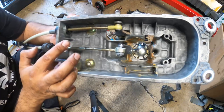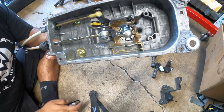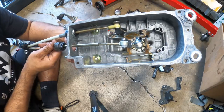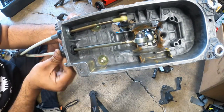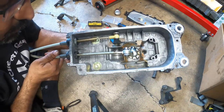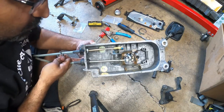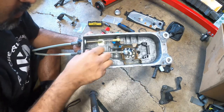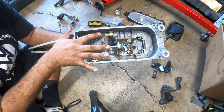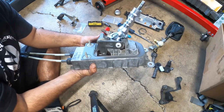All right, this is pretty much the repair for these bushings, because you cannot actually find these bushings normally online. They're a pain in the booty. But yeah, and then last but not least, put in your cable here and then your locking clip. Just like that. So now we've repaired the bottom with all new bushings. C-clip here for this guy, and then on top we put a short shifter.